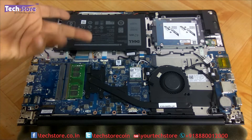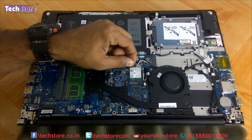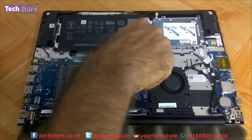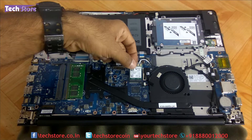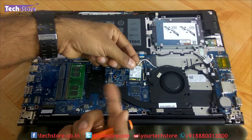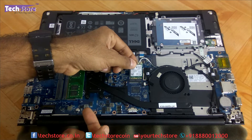For the Wi-Fi area, there is a plastic cover holding the chip. First remove the screw, and the entire Wi-Fi chip will be free. You can then detach the two antenna connectors. You can insert a replacement Wi-Fi chip or an NGFF M.2 SSD in its place and connect it back.